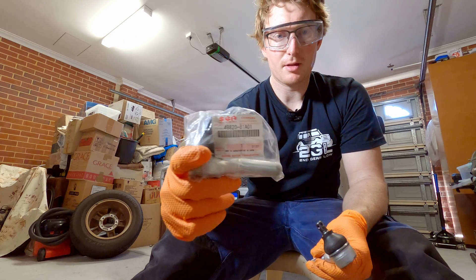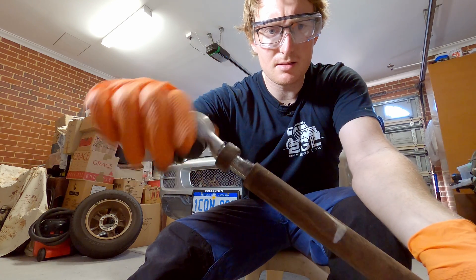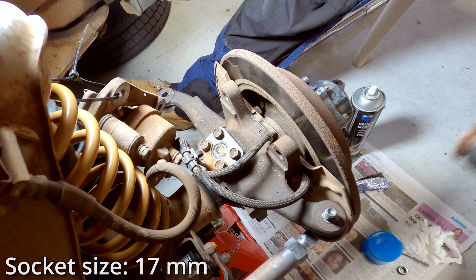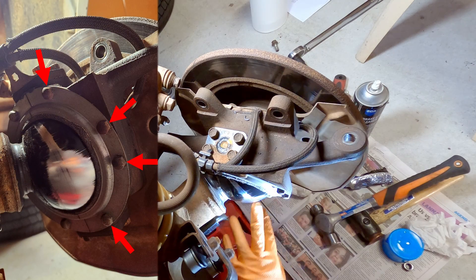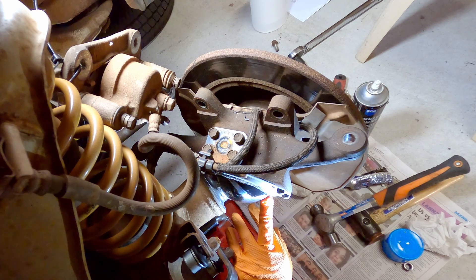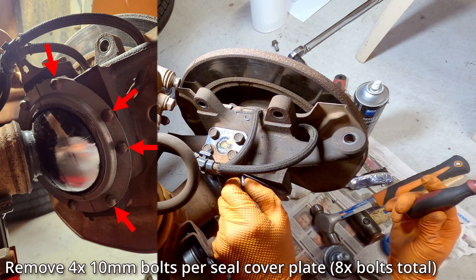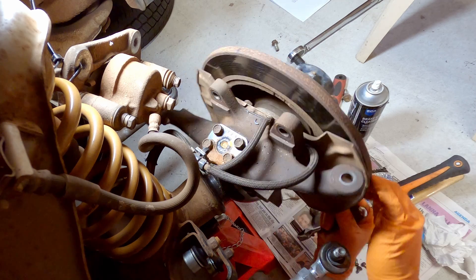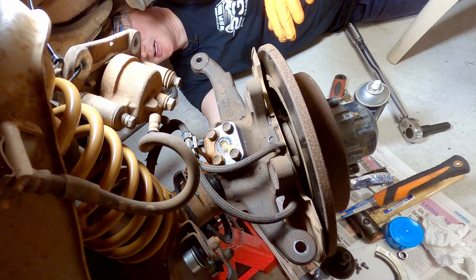I've had this apart quite recently. If you want to know how to change your tie rod ends or drag rod ends, or if you notice the rubber boots are leaking grease, check out episode five of our rebuild and restoration series. So onto the drag rod now — same thing with the copper hammer, pop that out and now that's free to move. Now we just need to remove the eight 10 millimeter bolts holding the knuckle seal onto the back of the knuckle, which will allow us to rotate it freely. Make sure you don't damage the seal because we're putting it straight back on. I've got the knuckle seal cover plate with felt on it, and behind that a rubber seal to pop away as well — along with the steel ring that sits behind it — and we're just going to hang them on the axle housing behind.